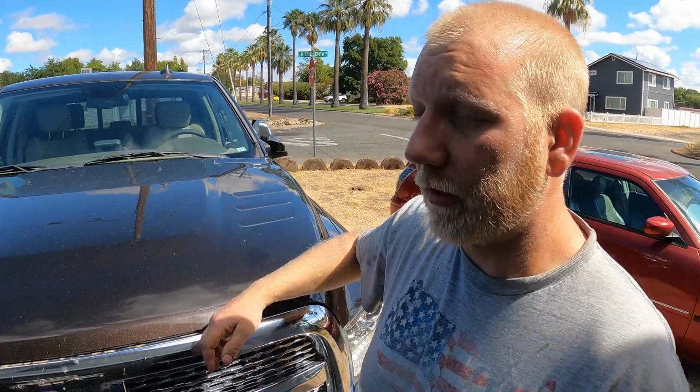But you basically want a big open road, of course. You don't want to slam on the brakes and have someone run into the back of you. But you go 20 miles an hour, and then you hit the brakes pretty much as hard as you can without activating the ABS and skidding all over the place. And do not come to a complete stop. Get back on the gas, go up to 40. Do that again, almost as hard as you can, almost to a complete stop, but not quite. And then 60, do it again. By then, you should probably be smelling the brakes.